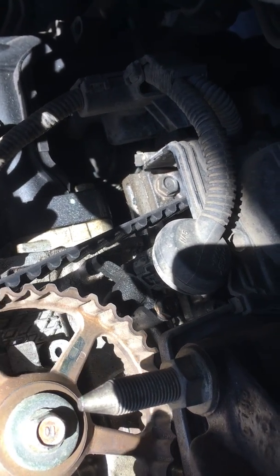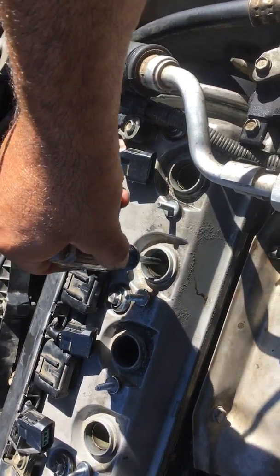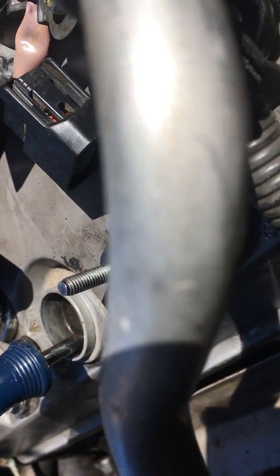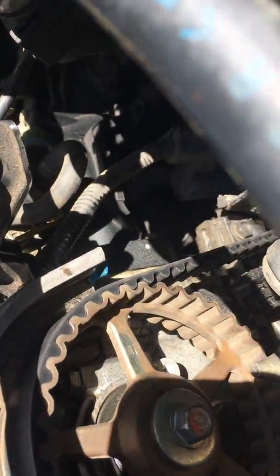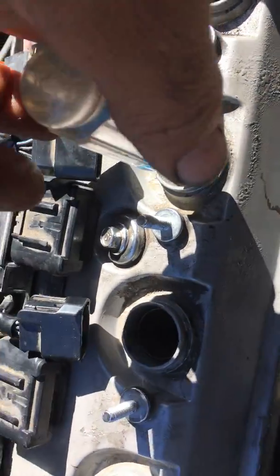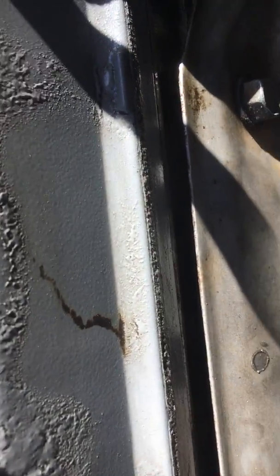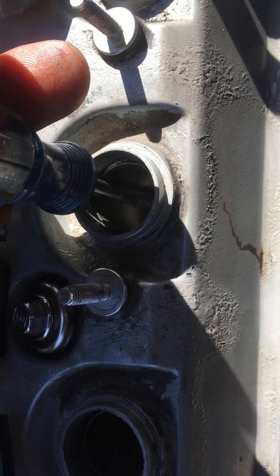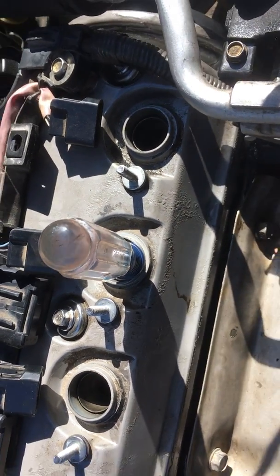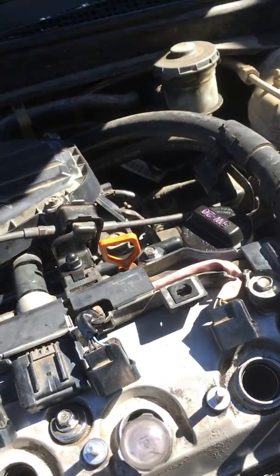The last one - that 'UP' is right there. We're gonna move to the second one and watch this guy. As soon as he starts going down - see how he hesitates? You can see the 'UP' right there, that's the position it should be in for piston number two. Now listen to this. You guys just heard it - that's a bad piston. That's how you get the rod knock. The bearings inside the crankshaft are gone, and that's how you prove it. Hopefully this video helps.